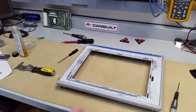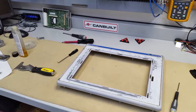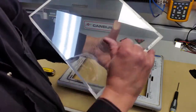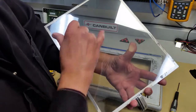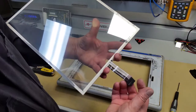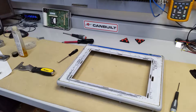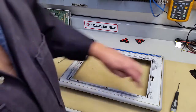Okay, here we're back after a little bit. As you can see, I've taken the glass out. Here is the touch screen glass — it needs some cleaning anyhow. This is the top side, and you see these traces around here? You do not want to scratch those. When you're touching it, if you look really close at the glass you can see these little dots — that's where all your interface comes from. So we'll continue on this — it's going to take a while, scrape it, soak it, scrape it, soak it. And hopefully it'll be clean. Once it's cleaned, we wipe it down with isopropyl alcohol to make sure that the glue will adhere properly.